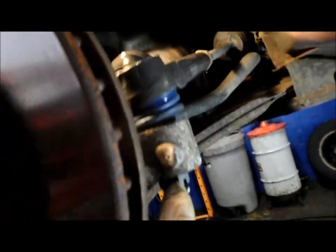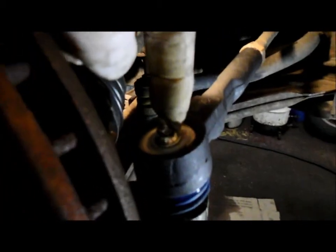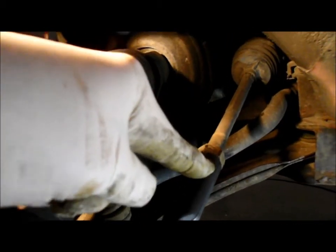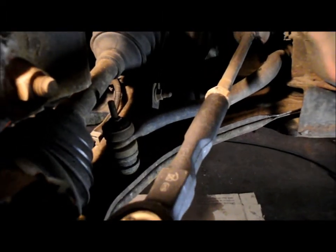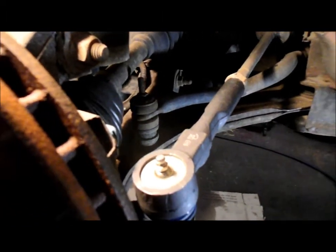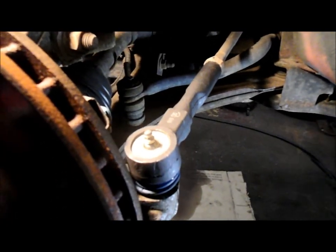All right, let me bring you over and show you. So we have our tie rod end through the knuckle, we put our washer on the bottom, put the nut on, tightened it up, and put the cotter pin through. We installed our new grease fitting into the tie rod end, screwed the tie rod end on, and tightened the nut up against the tie rod end. Next we're going to go to the other side and do the exact same thing. Obviously we're going to get the alignment checked to make sure it's still okay. Thanks for watching — any questions or comments, drop me a line. See you on the next one.